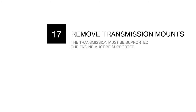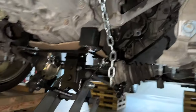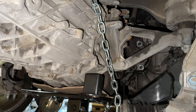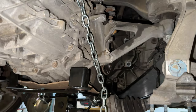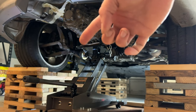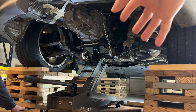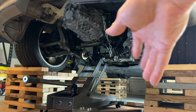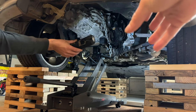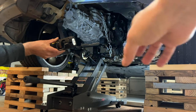Chapter 17: removing the transmission mounts. The transmission must be supported and the engine must also be supported with its own jack stand. The next phase is removing the four bolts on the side brackets of the transmission — on that bracket as well as this bracket. Then we'll slowly pull it out and slowly drop it. Comment if you are stuck on any specific steps that I don't cover in this video. We've removed the left tranny mount — that was easy. Right side tranny mount, also easy. The bolts around were a pain because half of them were rusty. Basically follow the guides and forums; leave a comment below if you need more specific help. Sorry, this was frustrating at times so I might have skipped a few steps on a couple of bolts. I hope this video is a good launch point — leave a comment and I'll find you the answer.